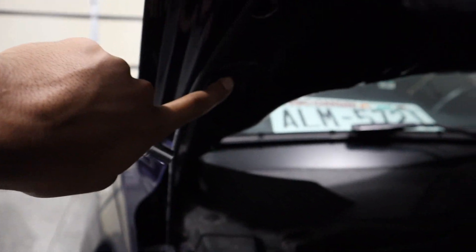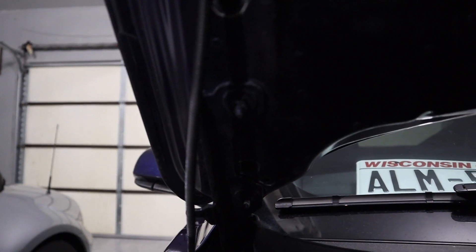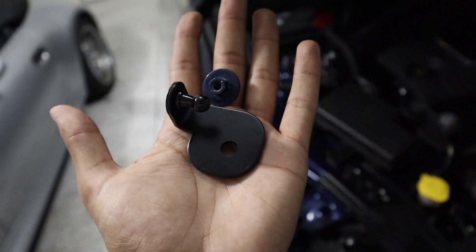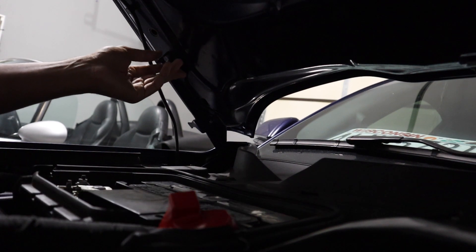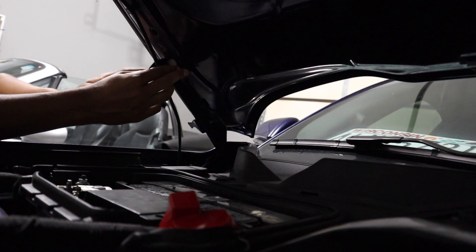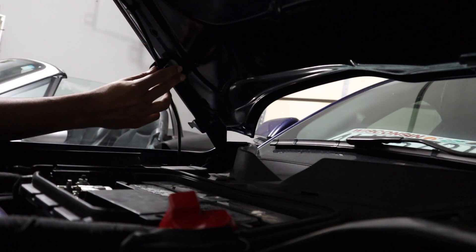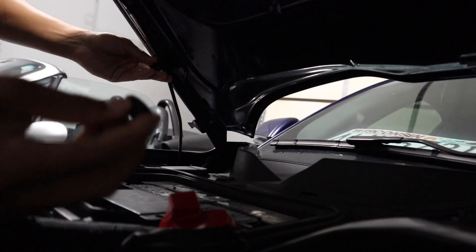The cover is off. The first thing we're going to do is use a 10 millimeter and take off this screw right there — we're going to take the one on the top off and then fit the other piece too. We've got the nut removed. Now we're going to install this piece so we can put the struts on. We put this piece on and then this should lay over this little piece here. If it doesn't, you have the wrong side — so make sure you have the right side.